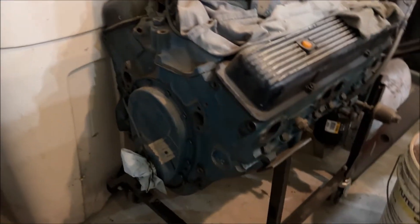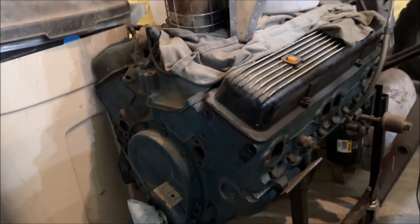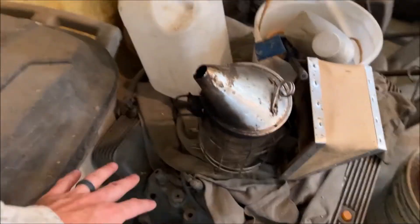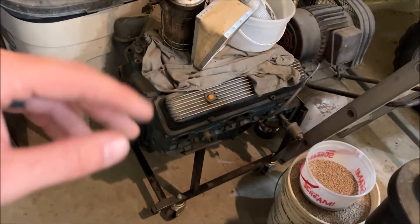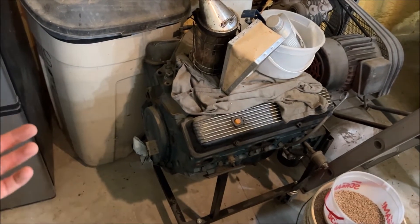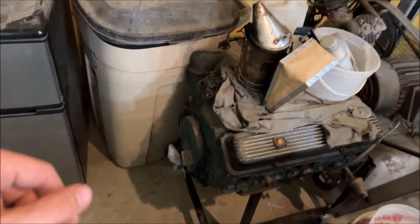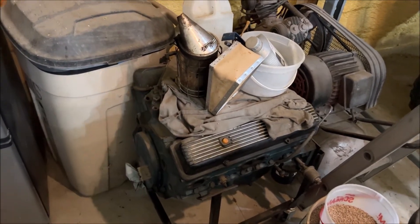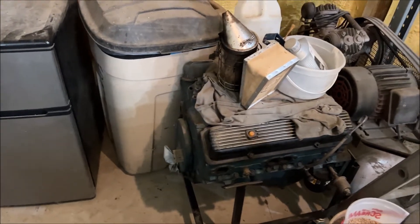Here's the engine — the long block at least — sitting underneath some beekeeping material, ready to be rebuilt. I did end up taking the cylinder heads off at one point. There was a large amount of oil all the way through the carburetor, which I took off, all the way through the intake — just covered in oil. When I took the cylinder heads off there was a broken piston ring on cylinder number one and a massive scratch down cylinder number one. So I need to get this whole block bored out or put a sleeve in cylinder one.